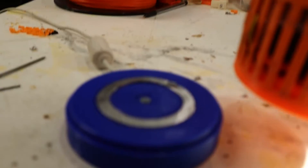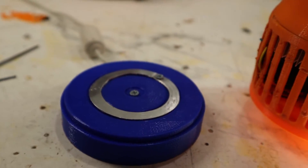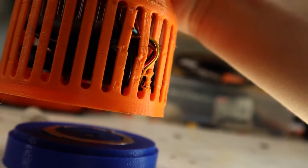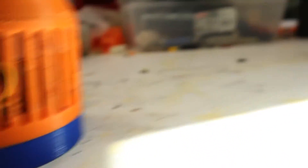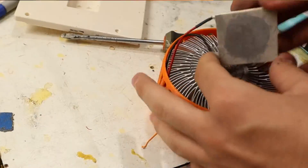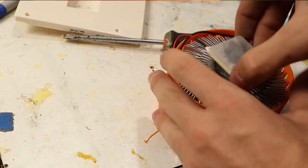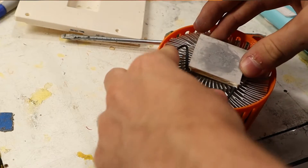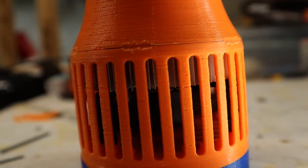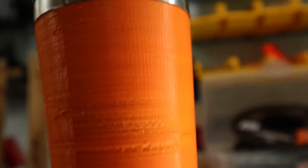Okay, that's a bit too close. So here you've got two rings — the outside's negative, the inside's positive — and for that I have two springs down here that contact with those pins. Once you put it on the coaster it turns on automatically. You can see the little motor in there, there's a heat sink right there, and on top of that is a peltier module, which basically just shoves heat from one side and puts it on the other, so one side gets cold, the other side gets hot. It's extremely inefficient — that's why this cup draws about 40 watts and it takes like four hours to cool your drink to a normal temperature. Fan, heat sink, peltier module, then cup, and a bunch of thermal compound in between.